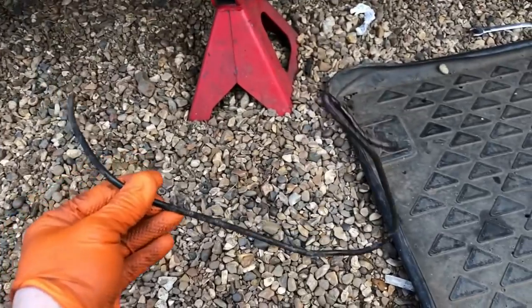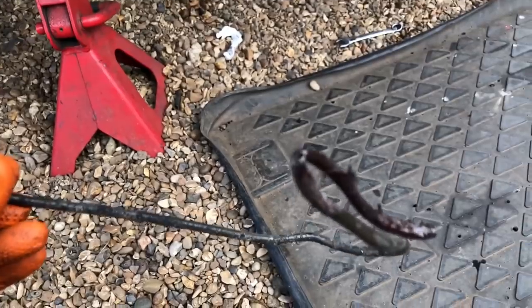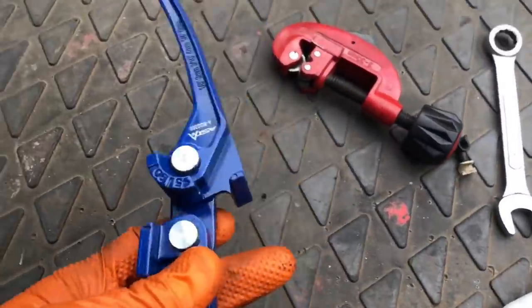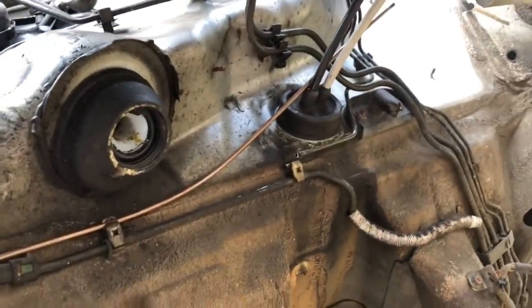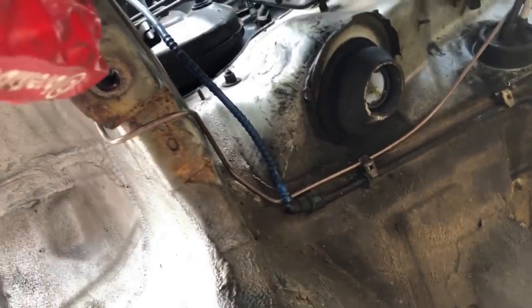Perfect time to replace the brake lines while the subframe is off, because obviously they go underneath the subframe. Just twisted this one off and once we took it off you can see how nasty it was — it just snapped in half. That's what they all go like because of where they wrap around the chassis leg and go nasty. So we just knocked up a new brake line — we've got a proper bender now so we can bend the line. It's going to go up here and then join along here — no point having to go all the way up to the ABS pump. Just quickly wire brush this down, there's a bit of surface rust, and then we've got a nice fresh brake line — a safety issue sorted out.